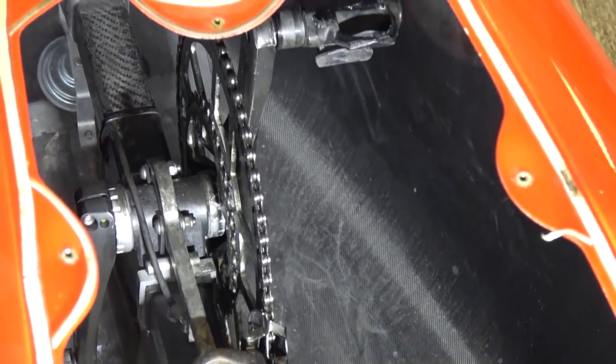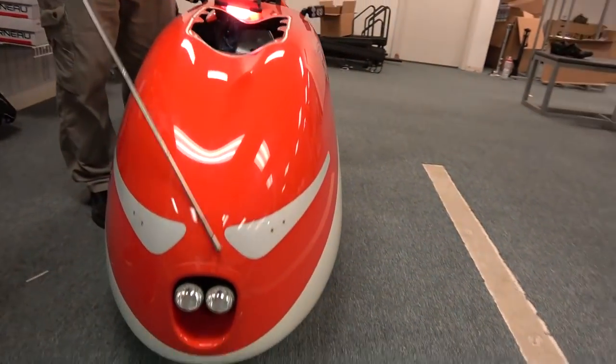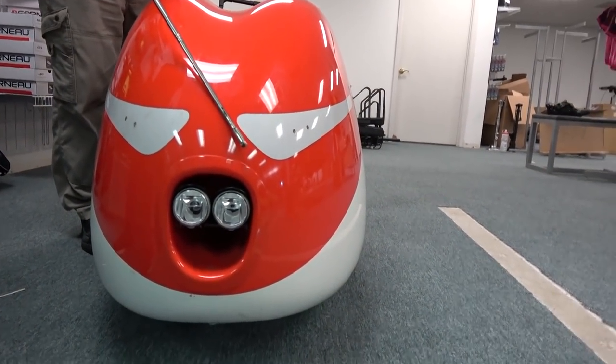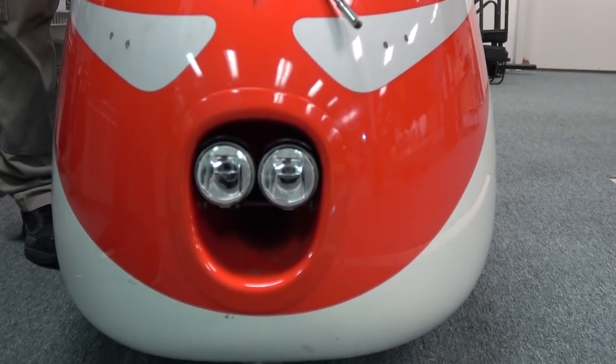What's really interesting is this sock — this is where air comes into the sealed compartment. There are no foot holes in this one, so there's a hole here which is the static air input port that brings air in from the front. If you walk around to the front of the velomobile and look down at the headlights — that's where the air enters the cockpit. It goes all the way through and empties out just behind the bottom bracket, flowing across the front of your body just like a trike would.